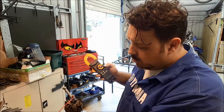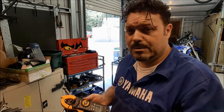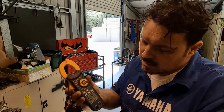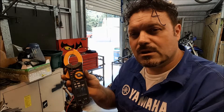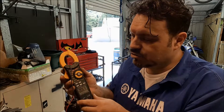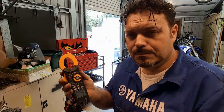If we put it around the wire — let's use the earth wire — and I energize, we can see how many amps are going to be consumed by this electromagnet. We've got 7.2 amps of draw by that winding that's inside the rotor. The electromagnet is consuming 7 amps of current. So there you go — how to test that as well. It's also really a demonstration of how to use one of these tools and what's really going on, so you can understand for diagnostic reasons.